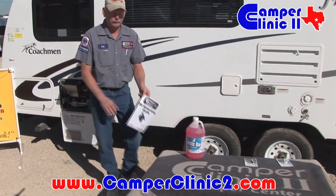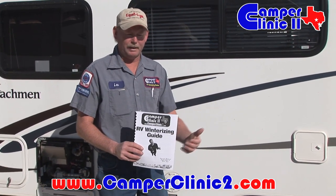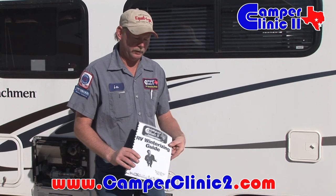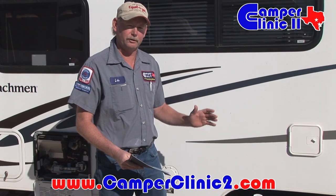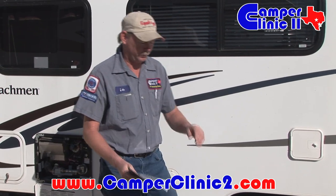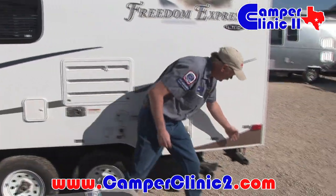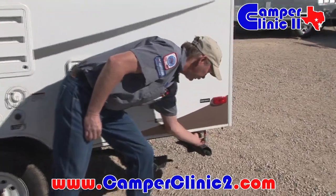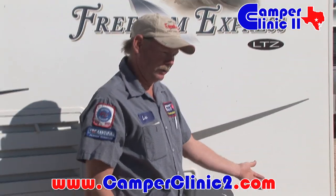If you have any questions, contact us at the website, Camper Clinic 2. We also offer a manual that may be helpful to you — more than happy to send it to you. So I'm going to discuss this particular unit, but keep in mind things in your unit may be a little different, though the procedure is pretty well the same. In the back of this unit there are a couple of low point drains right here — this red and the white. Red is obviously the hot water side, white is the cold water side.